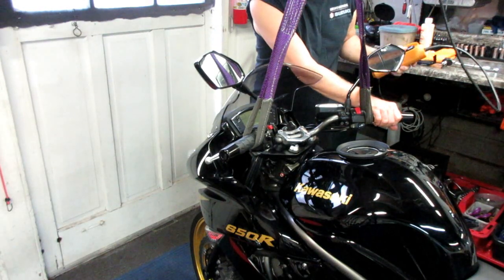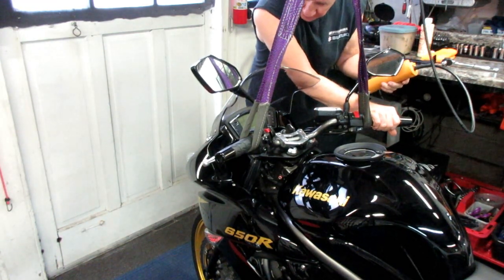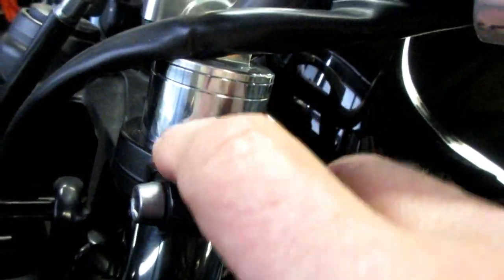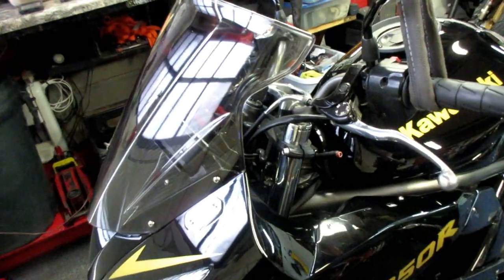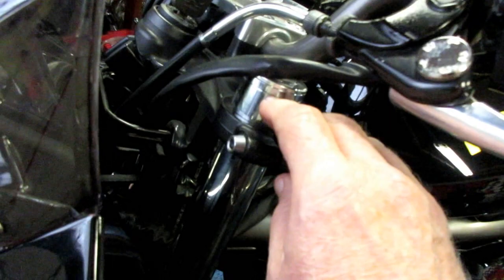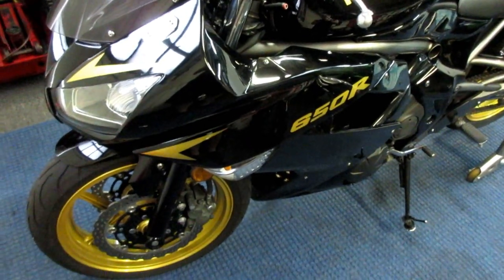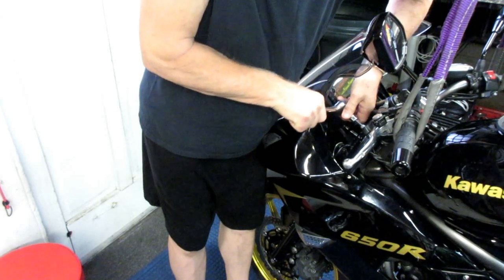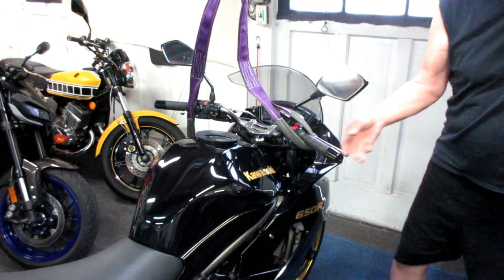Every time I lower the bike a little bit the tubes come up. It looks like they're coming up equally. I notice they have scribe marks on here, so possibly this set of forks fits other models and they leave that exposed. I'm going to start with the maximum amount, put the bike back on its feet, and see if I have any interference issues. If I have no interference issues, I know it's fine — and I can always go back to half the amount. This is fully adjustable in a very short amount of time with almost no effort and zero money. It's an adjustable feature every bike has. Now the next step is to re-tighten all the bolts and take the bike off the stands and strap to check for interference issues at this height.